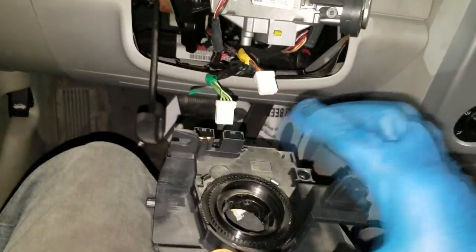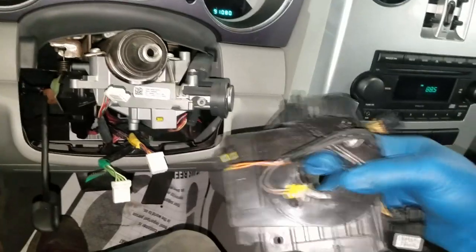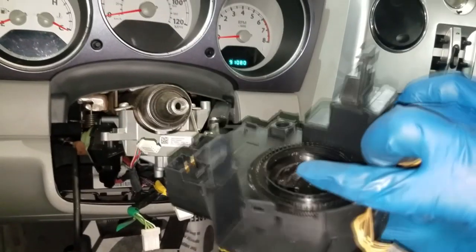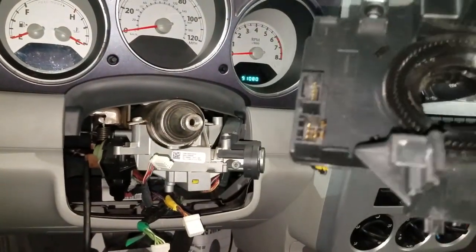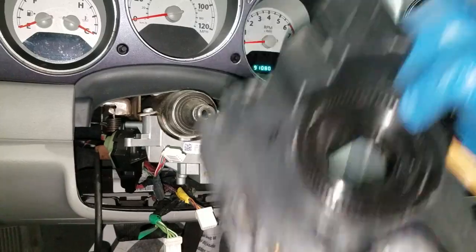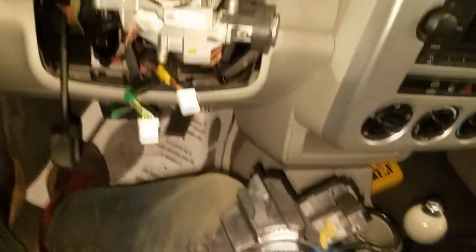There you have it — there's the clock spring. It's a squib circuit open. That signal goes through the clock spring. The horn didn't work either, so chances are there's a short in here somewhere. It may be right there — you see that connector? Looks like it's been physically damaged.